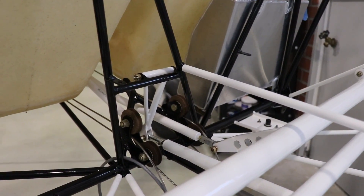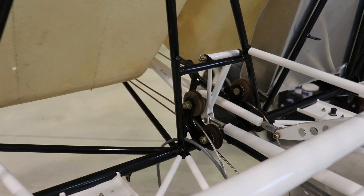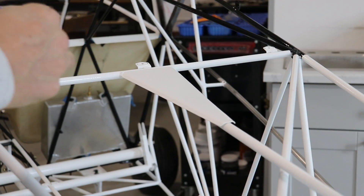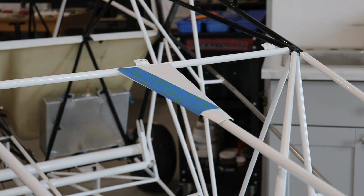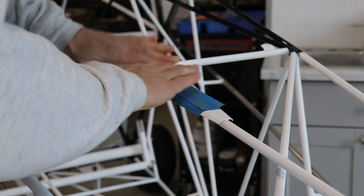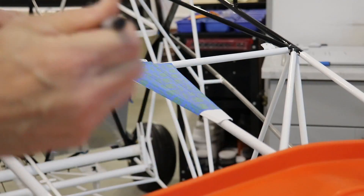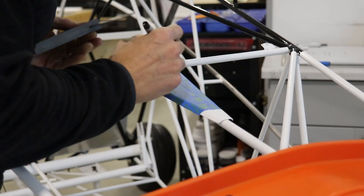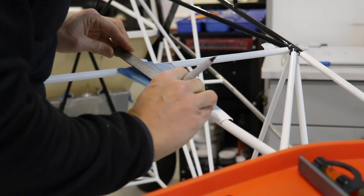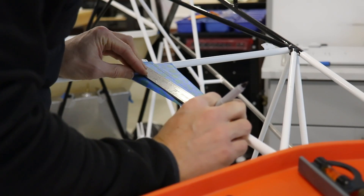From the bottom I can see what kind of space I have to run wires under the seat pan and back to the antennas and the elevator trim. The next task was to get the COM antenna mounted. This is the plate the COM antenna gets mounted on. I'm putting tape down for two reasons: one is to not scratch the powder coating, but mostly so I can draw a center line, mark where the holes are going to get drilled, and not draw on the white powder coating. I put two little marks at the center of the plate and used a straight edge to draw a line on the tape.